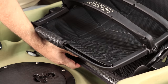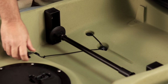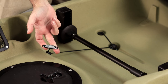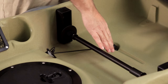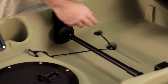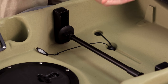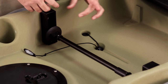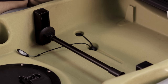I'll pop the seat out so you can see another feature — this is called our speed drain right here. Underneath your leg in the front you've got a little handle that says 'drain.' When you pull that, it will evacuate any water that's in the seat pan area down the drain. If you uncleat it, there's a bungee that closes up to keep water from coming in. As long as you've got some forward momentum, there's a little guard on the bottom that creates a venturi effect and takes the water right out.